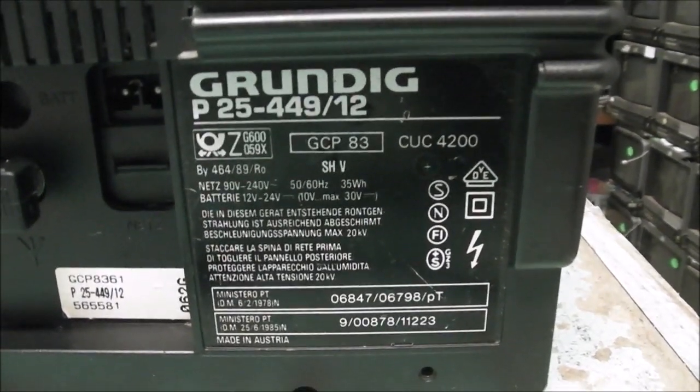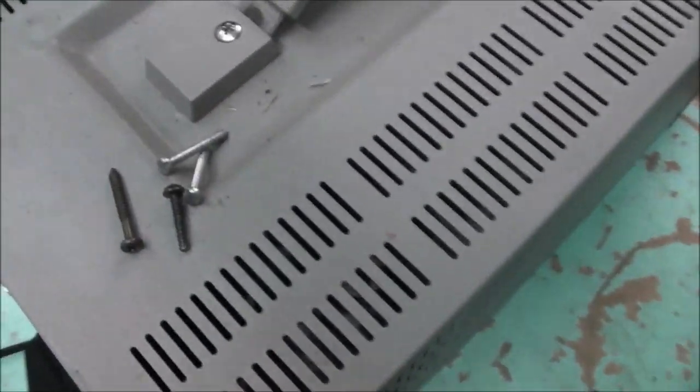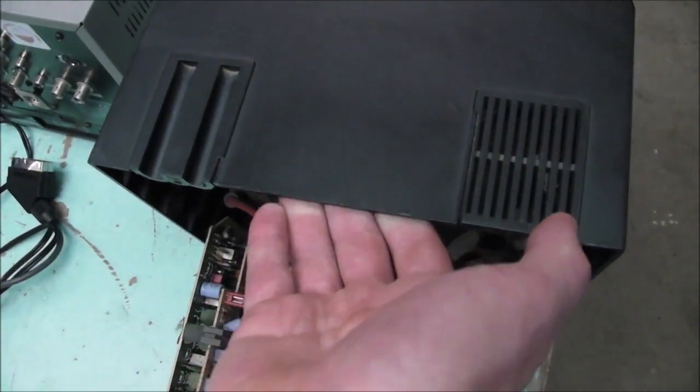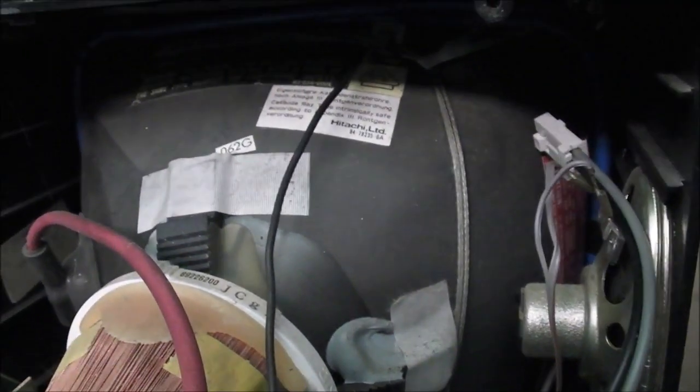What we'll do now is undo it and have a look inside. We have the back off — four screws held the back case on, no cables connected to it, easy to slide off. Worth pointing out that you can carry this TV via an alcove in the back case. Inside there are a few standing-up PCBs, a little chassis, and the tube.